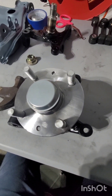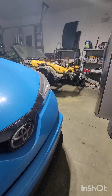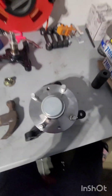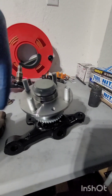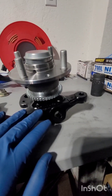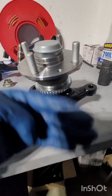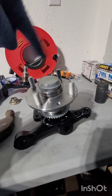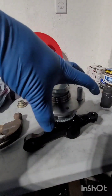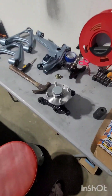It's a lot easier than the rear. The front does have a bunch of ball joints and cotter pins that can be tricky, but there you have it. That's how to do the front knuckle and hubs with bearings. Once you put a new one in, clean it, use a scuff pad to smooth the edges, wipe it down, put assembly lube onto the spindle and a little into the inner races of the bearing that's already pressed inside the hub, and it'll just slide right in.